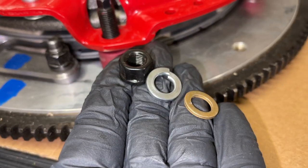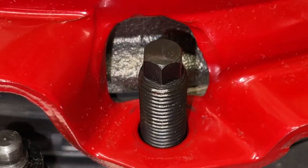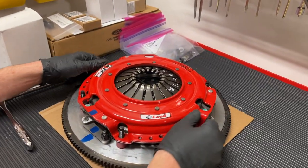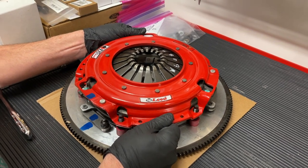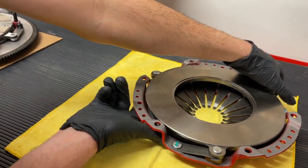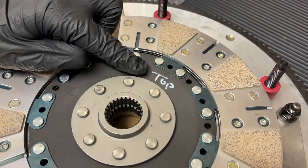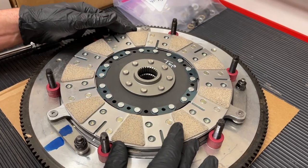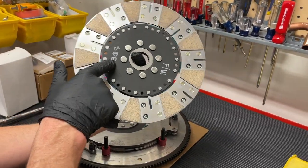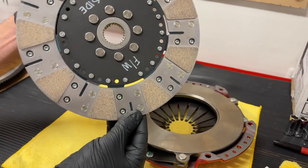Here's what you have for the top part of the pressure plate — these are studs coming out from the flywheel with a little hex on top so you can remove them if needed. With all six nuts removed, we go ahead and lift the pressure plate off the rest of the arrangement. We flip it upside down and gently set it aside — don't touch any of the surface area, keep it clean of grease. Now you'll notice the first disc says 'top,' and the back says 'flywheel side,' while the other side is the pressure plate side.